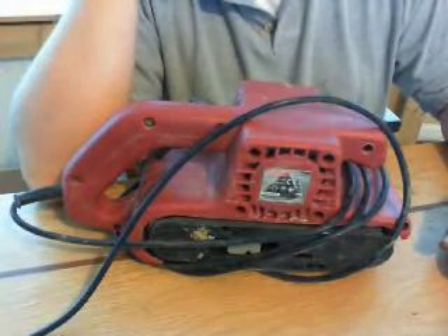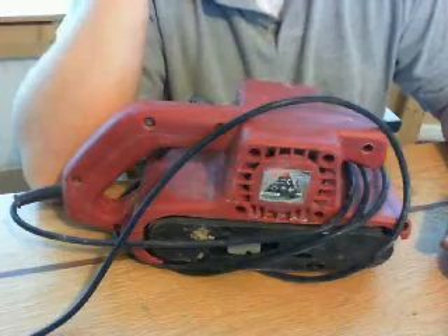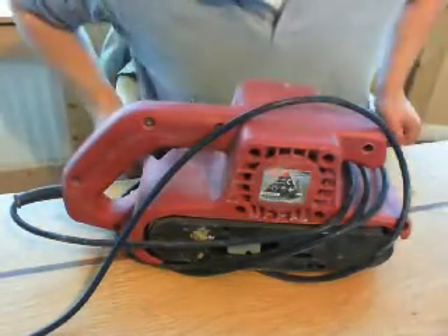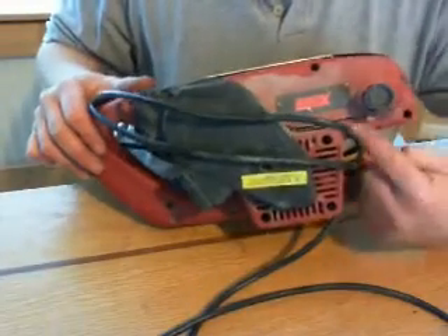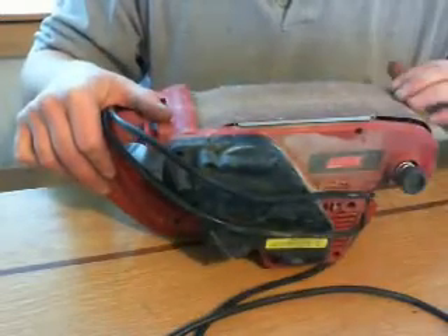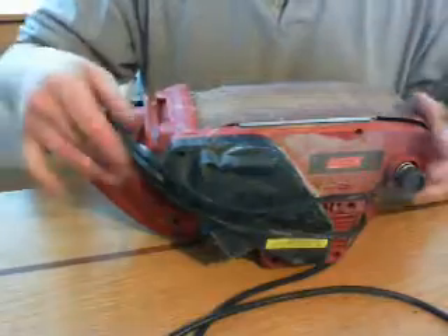So this is what we are going to use for the rollers and the motor. It's an old sander that I've got. It's so old now, but I managed to saw through it with the sandpaper there - it kind of wrecks it. It's because the belt tension was wrong and the sandpaper went that way and sawed through the body. And it's clogged so it keeps jamming.